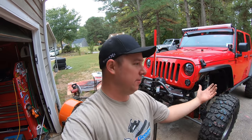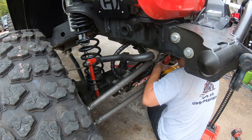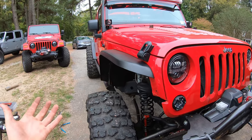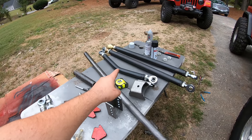Last night I made decent progress and we're back at it today. This morning I went ahead and cut the passenger-side upper control arm mount off — still need to go back in and grind that down smooth. We're waiting to weld that piece on. Our next steps are interesting — we're going to start putting on links to remove the old ones, then cut the old brackets away. Let's go ahead and get this upper link on the Jeep.